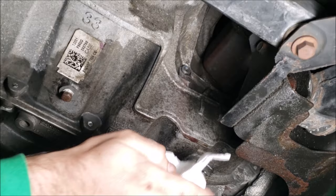So now that we have the wheel off, we are going to go back and make sure that our ride is at level riding height. So I'm currently at 21 inches here. I need to go back down to 16. Okay, so now we are at 16 inches with this trim line, suggesting that the vehicle is at level riding height. So I now have my drain pan right underneath, and we're going to start the car and unscrew that.